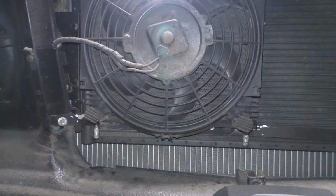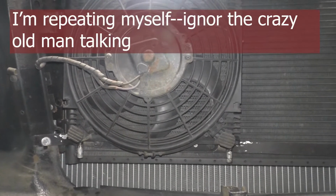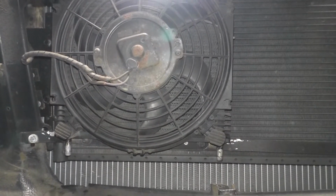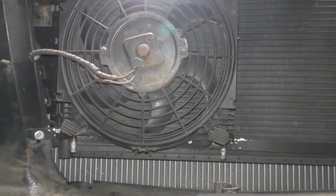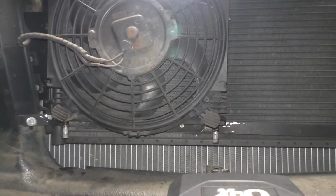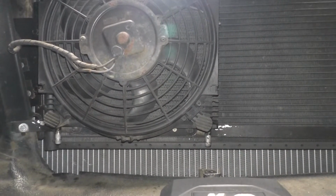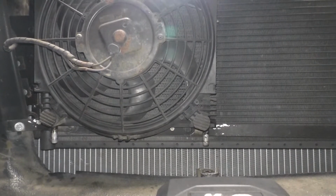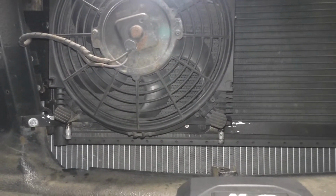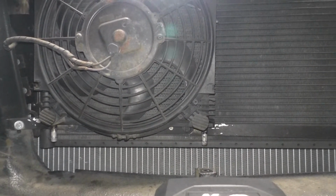On my trucks, I found that it doesn't make any sense when you're working something hard off-road to introduce 190, 200 degree engine temperature into your transmission fluid. So I always bypass the radiator and go right into an auxiliary cooler. I found that normally a transmission running on the road will run at around 160, 170 degrees, and working it hard off-road, I've never seen them go over 190, 200. So that's a lot lower than the average of 200, and then when you work it real hard it goes up to 220, 230, etc. So that's what I'm in the process of doing now.